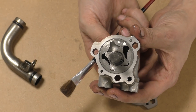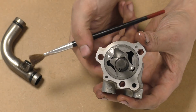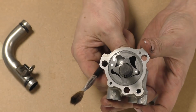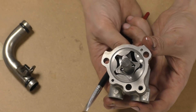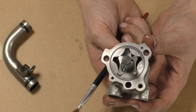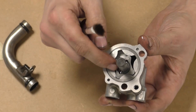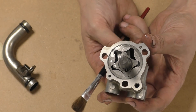Big chunks of debris — that's what the screen is for. The screen is to stop big chunks. However, this doesn't mean the pump won't pump big chunks of debris — big chunks can get in here, literally sit in the void, and then get pumped straight back out again. It's just that there's a good chance that a big piece that's too big to get down into the hole, when it gets squished, will get trapped in the pump and literally stall the engine and damage your pump.